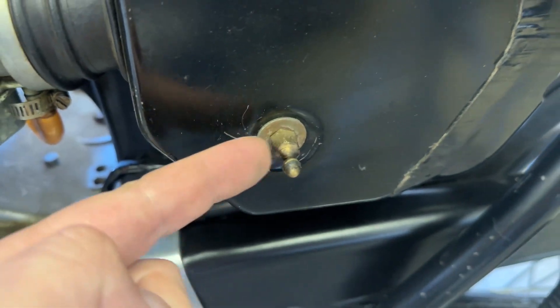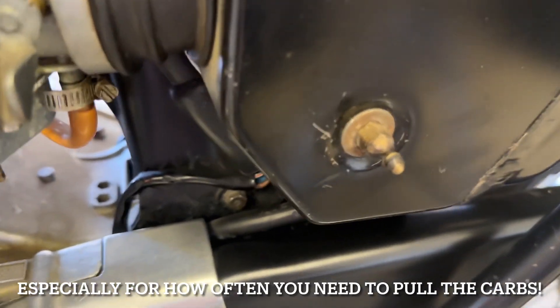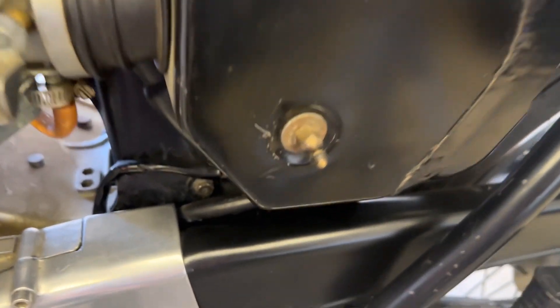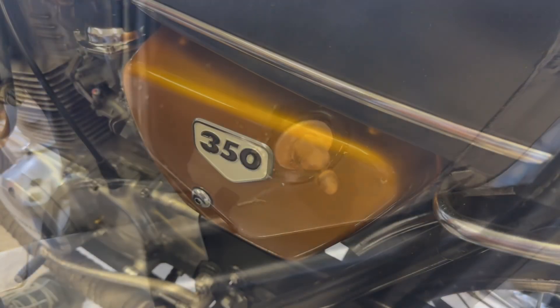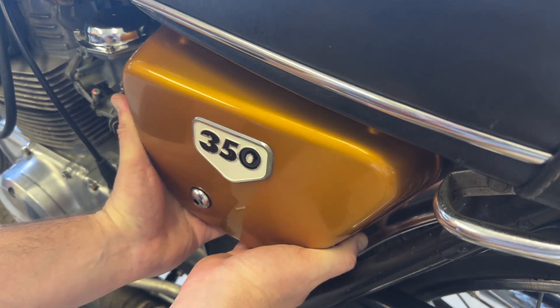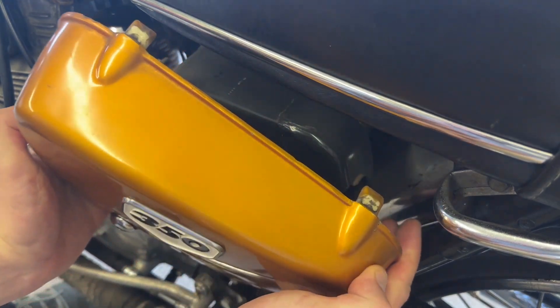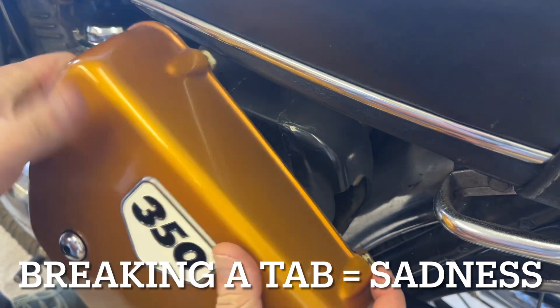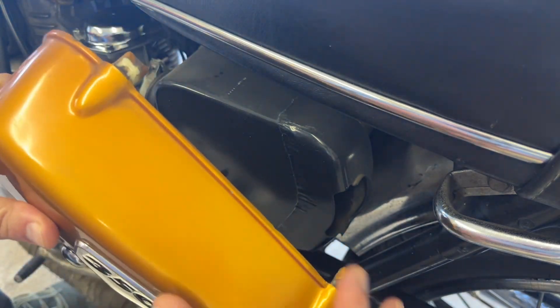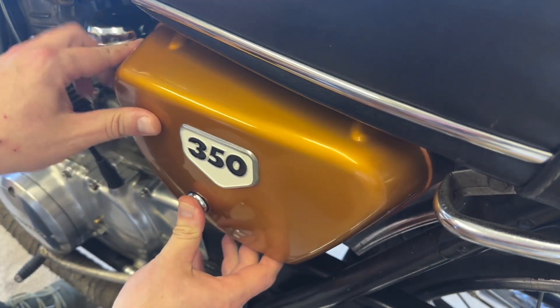If you're going for a full restore like I did on these beautiful side covers, these grommets on the side covers are an absolute nightmare — I absolutely hate this design. Next up is this connecting rod that goes through your air filters, all the way through to the other side underneath that cover. Trying to get that aligned, you're standing on your head — you have barely enough threads to get this bolt started. It's a maddening experience. I hate those connector rods for the air filters. It works great, but man, that thing is a pain.